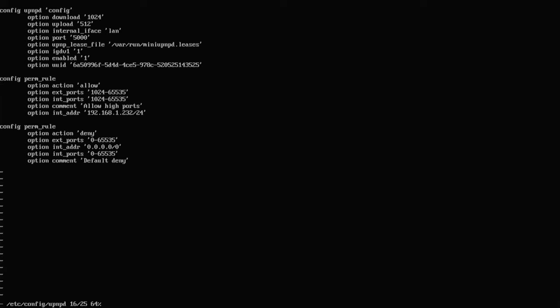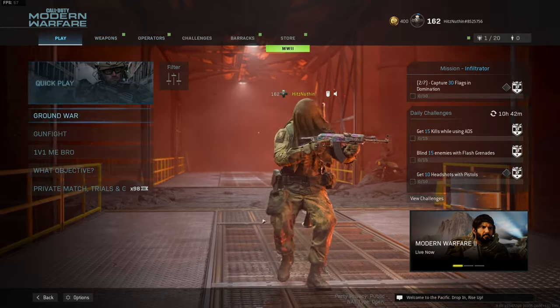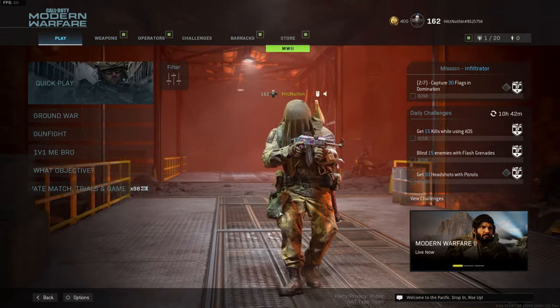Okay, so now I'm going to reboot the WRT router again from the GUI, and we will fire up, say, Call of Duty Modern Warfare, and you'll notice that the NAT type is now open. Okay, so let's open up Modern Warfare. And there you go. Down here, NAT type open. Normally I was running NAT type moderate, and every once in a while it would say strict. But using UPnP in OpenWrt with the correct settings will make sure that your NAT type is open, and that will help you find matches inside the game. And this will work for any game. I'm just using Modern Warfare because it actually shows this right here.